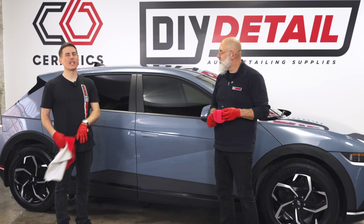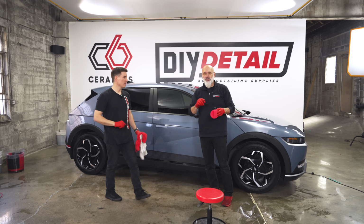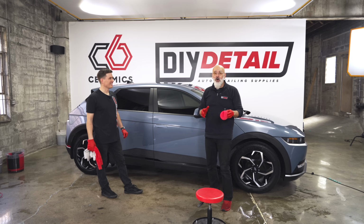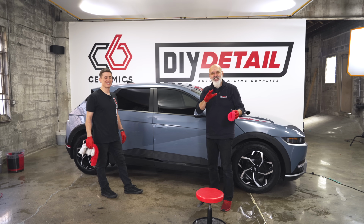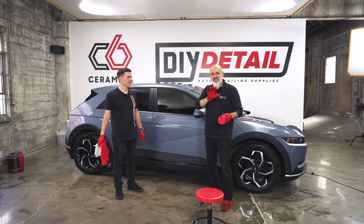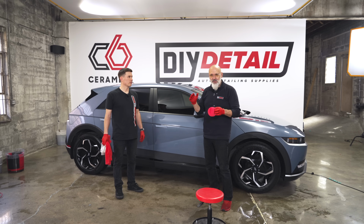Ivan, we're done with the 8-year coating, and now the big thing out there, wait 2 hours before you do anything else. 2 to 8 hours. And don't be tempted to say, oh, I'll do it faster. No, go for lunch, go sit in the spa, go for a walk. Go sit in the spa? Hey, if you have one, use it. That sounds nice. Yeah, but just for 2 hours, relax, let the 8-year do its thing, then you can start applying the 3-year. Please, please, wait a minimum of 2 hours, but you only have 8 hours to do it. So there's that 6-hour window that you can play with, but not before 2 hours, not after 8.